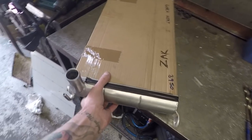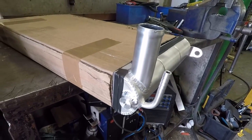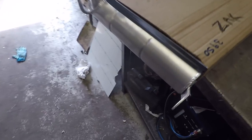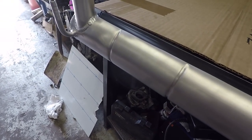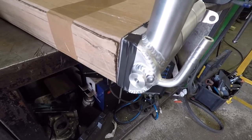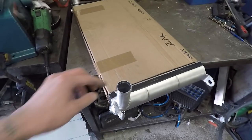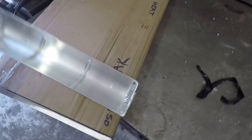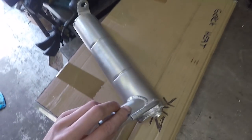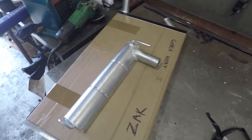So this is the rad so far. The end tanks are only just taped on to make fabricating all the bits and pieces a lot easier - I can take the tanks off, weld, and tape them back on. These tanks are just 70mm OD pipe cut in half, with a couple of little bead rolls in them for a bit of finesse. The thermostat takeoff is going to go in there as a little recirculating bleed, and obviously the main top hose inlet. Inside the tanks, fully welded top, bottom, outlet, and everything - just a mount at the bottom to hold them in place.